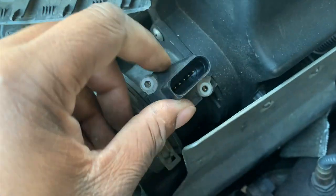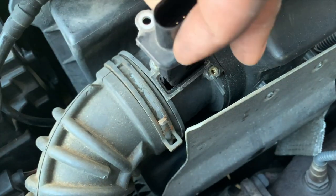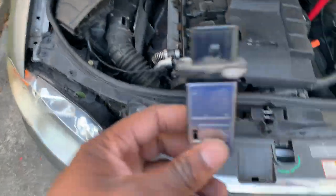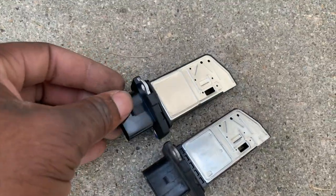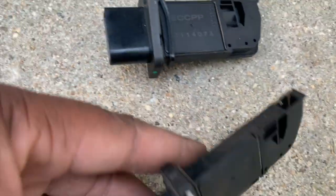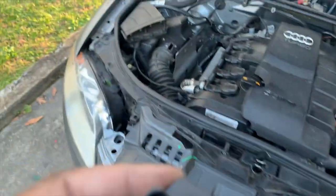Make sure you orient it correctly — if you put it in the wrong way, your hose won't line up. You'll see the oval part and the box, so it goes in this way with that corner going there. There's no way you can go wrong with this repair. Here is our new mass airflow sensor — let's do a quick comparison. The new one and the old one look the same, the model numbers are exact, everything lines up like it's supposed to.